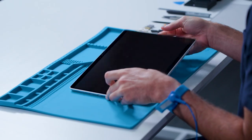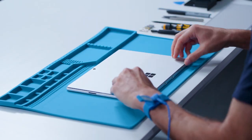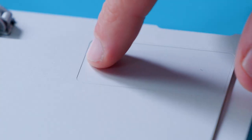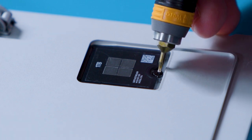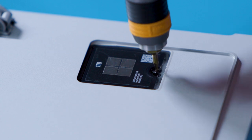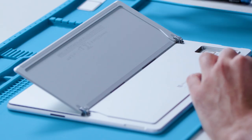Before starting, we'll remove the SSD, which triggers a battery shut down to the device to make sure power is not flowing during the repair. The SSD removal also prepares the device for display replacement. We'll press with our finger to pivot the SSD door open and remove it. The SSD is now exposed and we'll use our 3IP driver to remove the screw. The SSD can now be disconnected and removed with the help of a plastic spudger, then set aside on an ESD safe work surface.